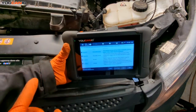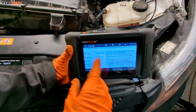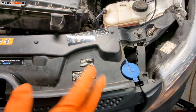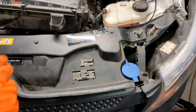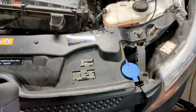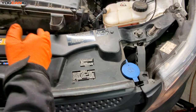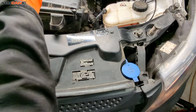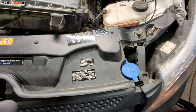After you've replaced that sensor and we still have that code, I might just need to start and run the vehicle a little bit, then turn it off and erase it — we're going to try that. Otherwise, just continue to drive your vehicle like you normally would. If that same code comes back on, then you might have to do some deeper research: whether the wire has a real short in it, the sensor was bad, you put a bad sensor in to begin with, or maybe something's really off with your timing. Thanks for watching.